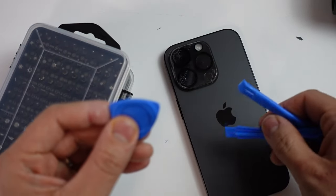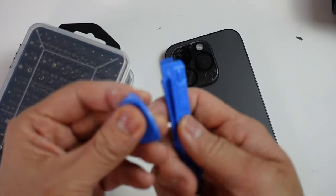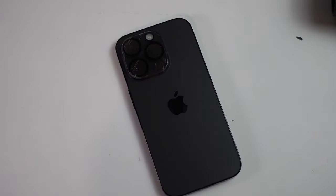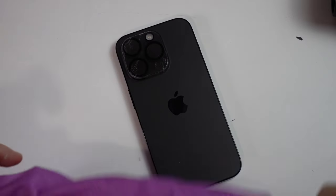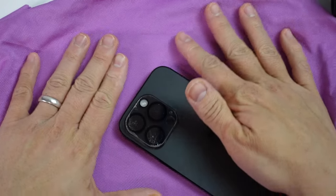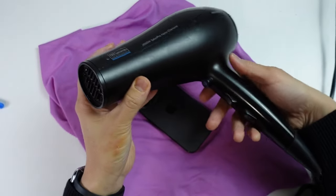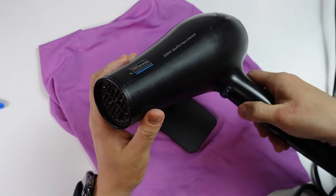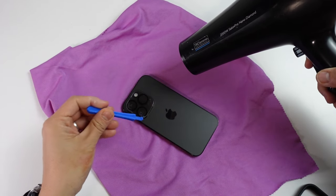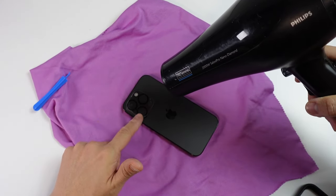The point of these is that you don't want to use a knife because you don't want something to potentially scratch the back of the iPhone or scratch the camera lens. You want something that's still firm but sharp as well. I'll leave a link to these in the description. The basic process is pretty straightforward — I'm going to put this cloth down so I don't have to worry about scratching the phone on the table, and then we're going to use our source of heat. I'm going to use this on a high heat mode and we're going to gently heat up this area, then use this spudger to work between the glue layers and get this lens protector off.